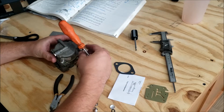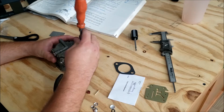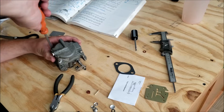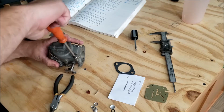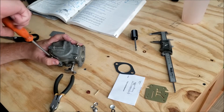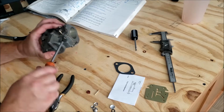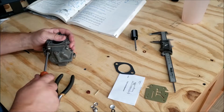I think they call it OMC screw lock. So I don't clean the screws or the threads because I don't want to clean that stuff off. So with that still on there, they won't vibrate out or anything. I like to go, you don't want to tighten one screw down at once because you may bend the bowl. So each one just goes a little bit at a time. So you reach the desired torque.